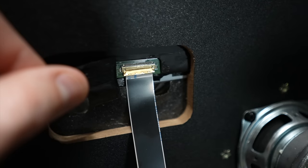One caveat about this whole thing is you do have to unplug the existing back box connection and then hook up this controller board every time you want to play these games from your PC. So if that's not something you feel comfortable with, or you want to toggle back and forth without unplugging wires every single time, definitely wait — because there is talk about having a dedicated switcher board so you can simply push a button and toggle between the stock built-in games and your HDMI 2-EDP controller board input.